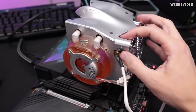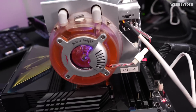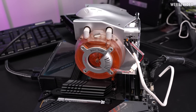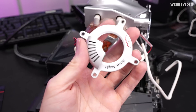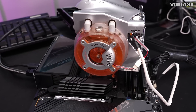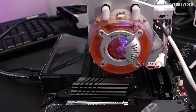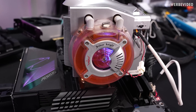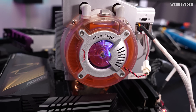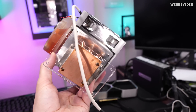Hmm. It seems like nothing is moving inside — that's not good. There are probably two reasons why it's not working: it could be a damaged controller, so we'll swap it from the other unit and see if that does the trick. If that doesn't help, it could also be that the pump wheel is simply stuck from sitting in the box for 16 years. So after swapping, it still seems to be the same condition — at least I cannot see anything moving. The remaining option is to try the second complete unit, which already has the controller swapped back in and the mounting plate added.